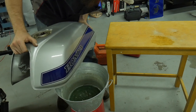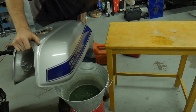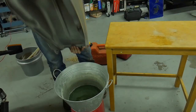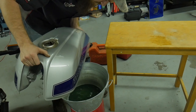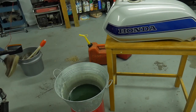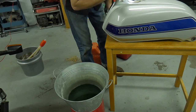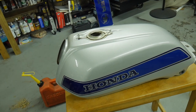Now what I'm doing is running a two-stroke gas oil mix through this — this is kind of my final stage of cleaning. These are my final stages of getting all of the debris I can possibly find before I dry the tank completely. Two-stroke oil and gas mixed just to flush the tank. This is me shaking the tank violently, trying to get it all to one side, bring it to that bung, see if there's any loose sediment down at the bottom, and again sucking it out with the strainer.